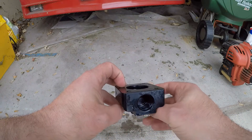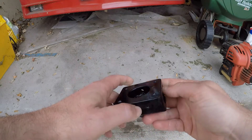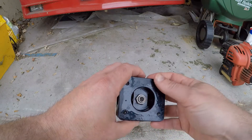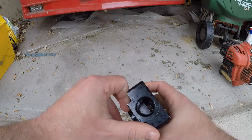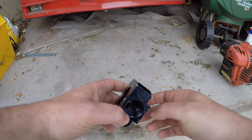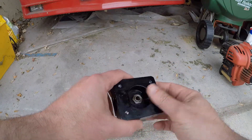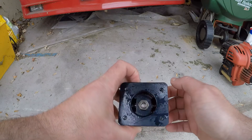All the threads look pretty good. I'm mainly concerned about any contaminants going through the fuel pressure regulator because I don't want to clog up my injectors. Otherwise I'm just going to run to the store, grab some seals and some oil for an oil change, put everything back together, and see if it'll fire. Got to set the fuel pressure as well, but yeah, I'm gonna start getting this thing back together.